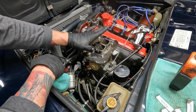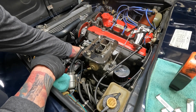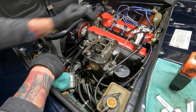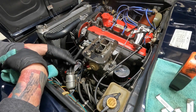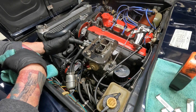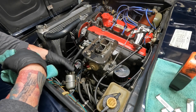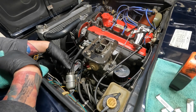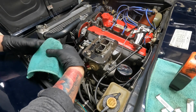This is the Weber I bought from VicAuto.com. I bought the Vic Auto manifold carburetor as a unit. So it's running the bypass filter because it's only equipped with one port on the carb for fuel inlet. There's no fuel out for the return line. So that's why this filter is on there. Can you see it? Yes, you can. Okay. And this is my filter for the oil dump canister over there, the vapor canister.